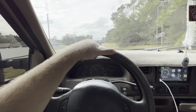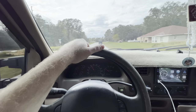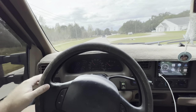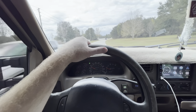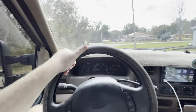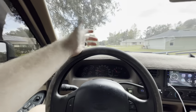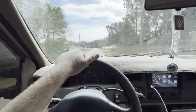I was this close to just ordering a built transmission — now I don't have to for a while. This transmission will probably last at least another hundred thousand miles. My fluid's pink, doesn't smell burnt, no slipping anywhere else — it was just in overdrive. It would randomly do it, and when I floored it sometimes the torque converter would stay locked and other times it would unlock and relock, causing the truck to jerk back and forth. Luckily it was probably only like that for five or six hundred miles, so it could have been a lot worse.